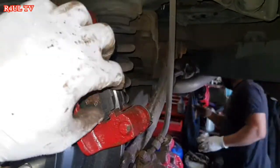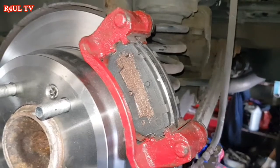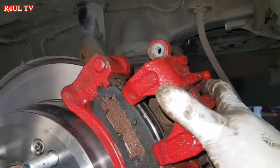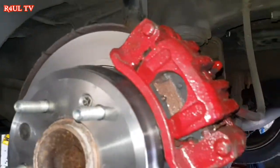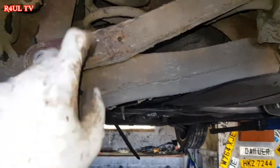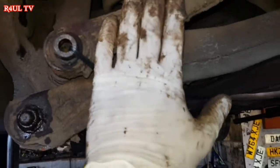We've got the pads on — as you can see they're nice and free. We want them nice and free, don't batter them on. Put the caliper back on — I'll need two hands to do this. Right, we've got everything back on here. The brake disc is back on, the caliper is back on, everything tight. We've got one more thing to put back — the arm, the wishbone arm, the rear arm. Last but not least, do not forget that. If you've done it this way, make sure you put this one back on as well or you're going to be in big trouble.